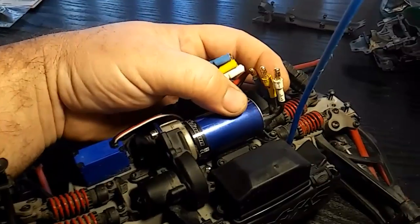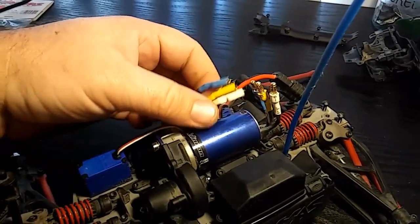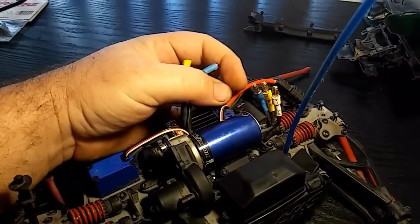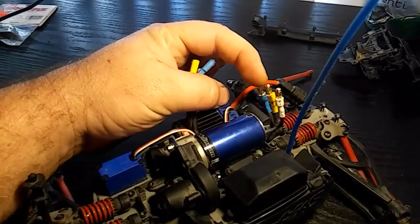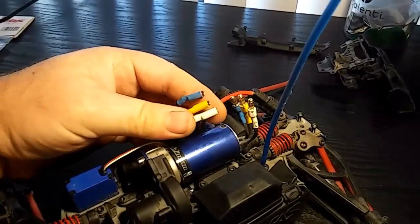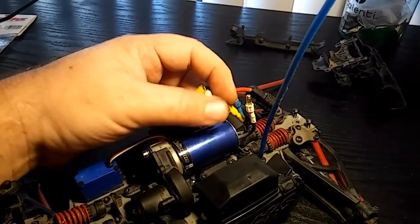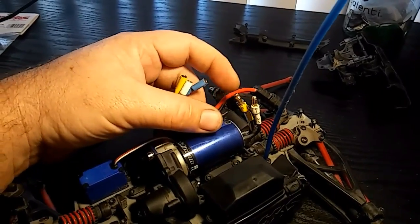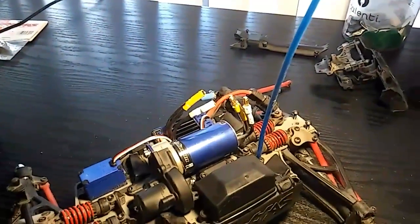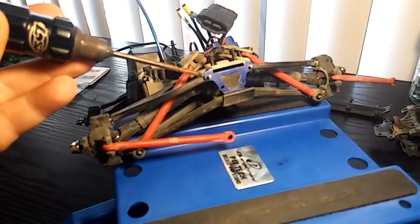Something important to mention: when you're unplugging these leads, if you notice any are black or discolored, that indicates a loose connection which will eventually cause a problem. If you have one that's extremely discolored, change all of them to new to avoid any future issues.